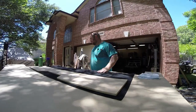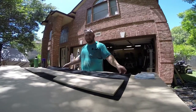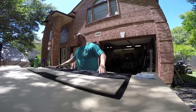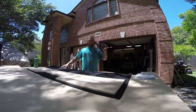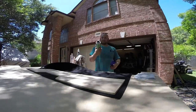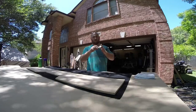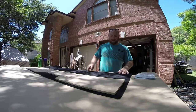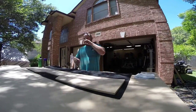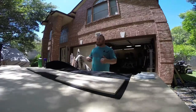Upholstery is definitely not something I'm great at. Basically we have a piece of carpet cut out double the size to allow overlap. We're going to use a combination of spray adhesive — I have Super 77 and CRC spray adhesive, either one is fine. I also have a little wooden roller for sound deadening material that helps get a good application. You spray this down and then it's easier to go in and cut the excess. Then we staple the back edges so none of the staples are visible.